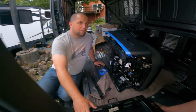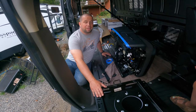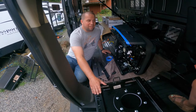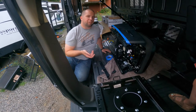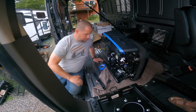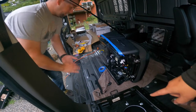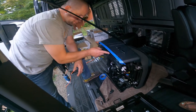Raise the seat up when sitting. Mount the swivel. Put the seat on the swivel. Raise the seat up when the power is still hooked up before you even take it off, so it's in the highest position — because you're only going to be able to swivel it when the chair is raised anyway. That way you know it's at its highest position before you measure and cut, and you'll clear the bar. So once again, raise the seat all the way up before you take it off and disconnect, so you know exactly where to cut.